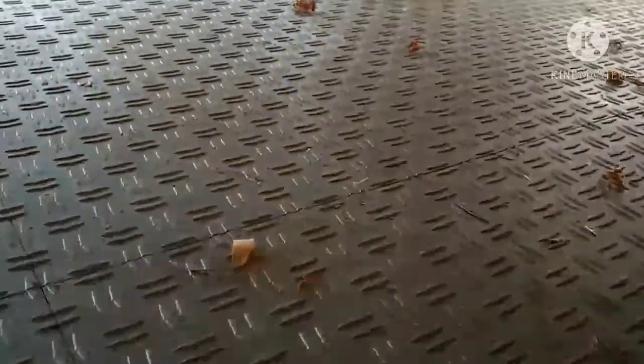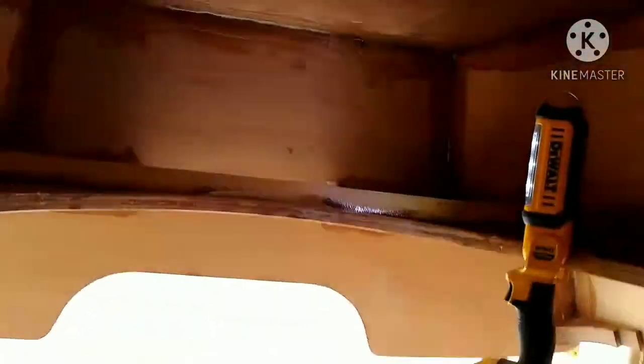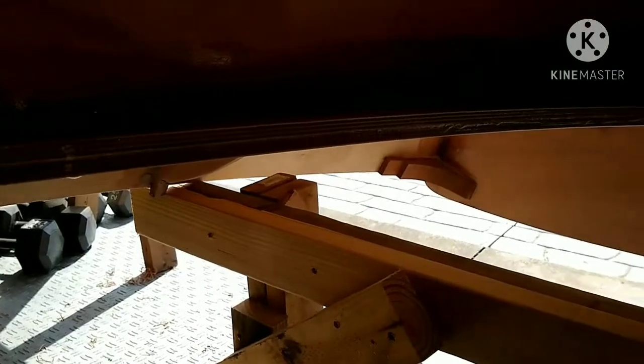All wetted out. This is the bow section. That's station 1. And then over here is station 2. We crawl underneath into the aft section. We get the full aft section. All of these joints have been fiberglassed. Fiberglass tape and thickened epoxy. Started on the outside.